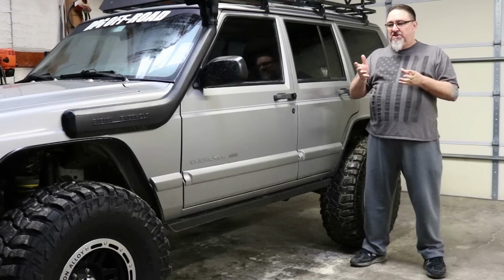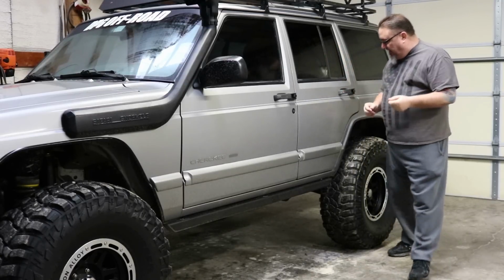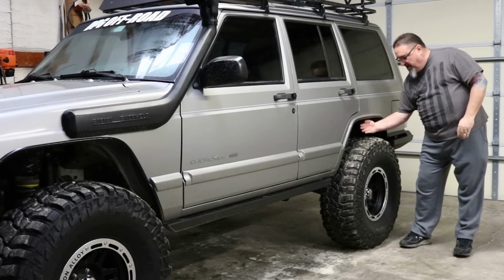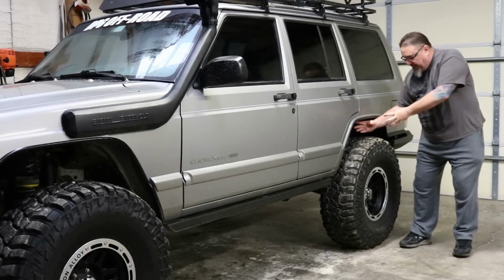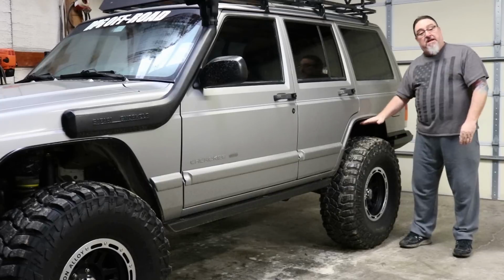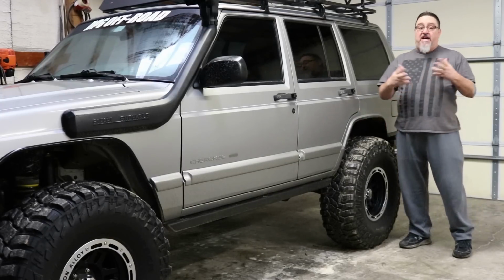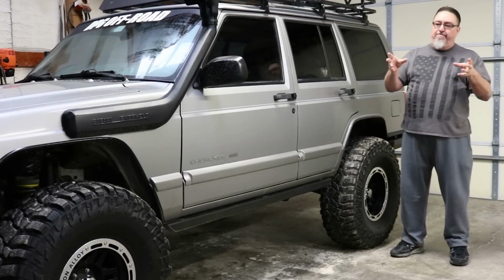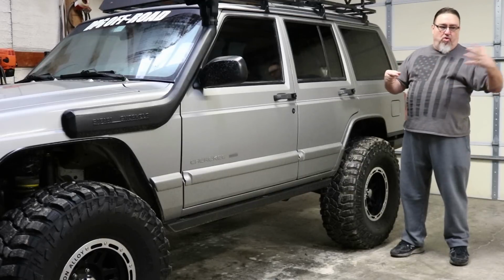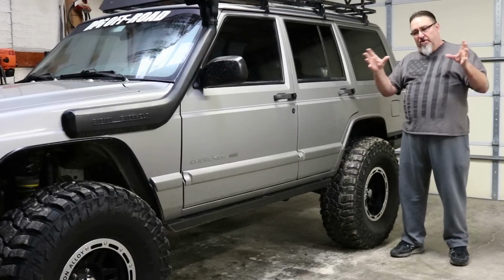The only thing that's saving it is on the stock rim, that tire, when it goes to flex, like if it's coming up, it'll go up behind the fender a little bit. But as soon as we get that wider stance and move it out, it goes up, it's out more, it'll go up and hit the fender instead of moving in and out behind the fender. That's one of the parameters where guys are having differences of opinion on what you can fit. Maybe 31s work on his and don't work on his. And those are the things to look at, are those parameters.